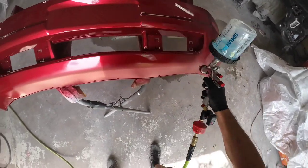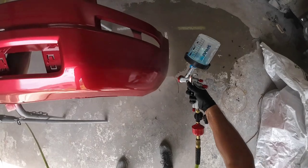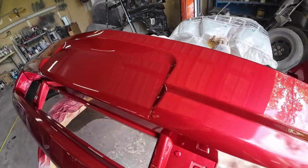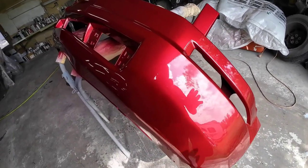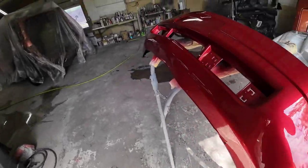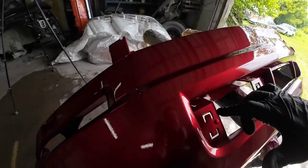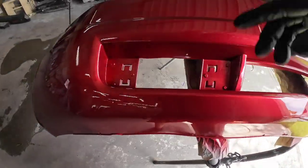If you're new to painting and spraying clear coat, I would just say experiment with it. Do a couple of test panels, experiment with your speed, distance, and different gun settings, and find out what works well for you and what gives you the results you're looking for. After the first coat, I sprayed a little bit closer to the panel with a little more speed because it's 100 degrees and the clear coat was drying really quickly. This is the first coat — we're just introducing that clear to the surface — and now we'll slick it out on the second pass. I'm going to dial my fan pattern down and hit this edge real quick before I start the second coat.